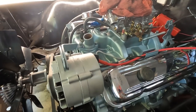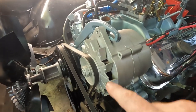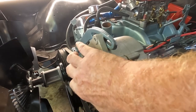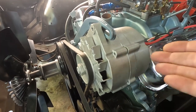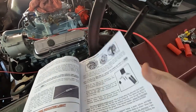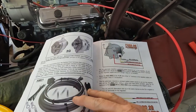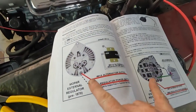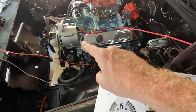That's the wiring to the alternator. My alternator is the GM-SI — there's a 10-SI and a 12-SI. The 10-SI is the one with the fan behind the pulley; the 12-SI covers up the fan that's on there. Your alternator could be completely different if you're following along with this. The good news is they've got pages and pages for all of the different alternators, generators, and even Chrysler. They cover everything with their own little details. For mine, that's how I hook up the GM-SI-10.